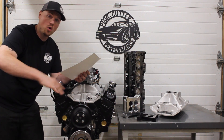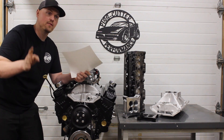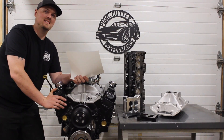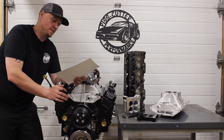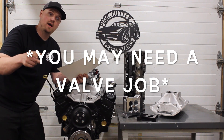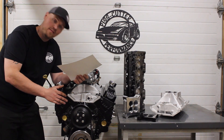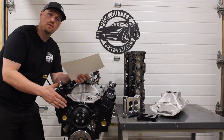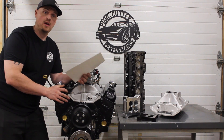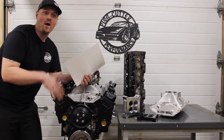Make sure you go back to my beehive spring on Vortec head video — it'll explain all that more in detail. We used the Felpro seals, which are SS72861s. No machine work done to the heads other than to accommodate the higher lift. You'll find when you take these Vortec heads down, the exhaust valves are always super pitted — pretty common. So I ended up just resurfacing the exhaust valves and cleaning up the seats a little bit. If it's low mileage, maybe you won't have to — it depends on how much you want to spend.